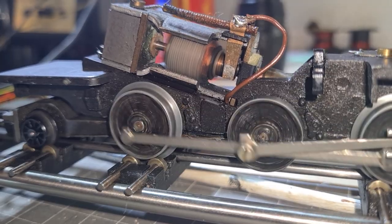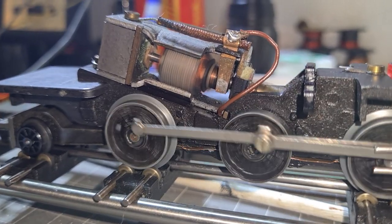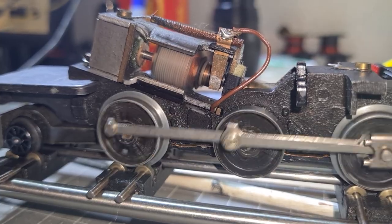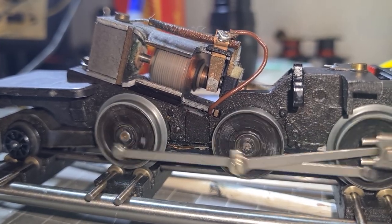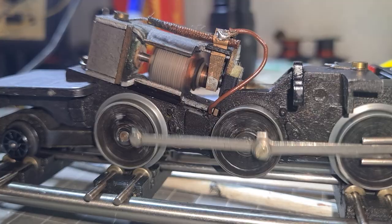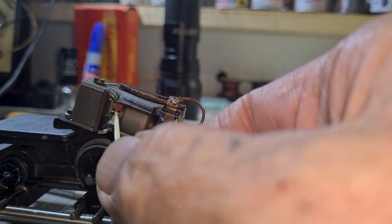You'll notice that the axle is made of steel and the housing of the bearing is brass. Over the years, I would suspect that the steel race has been wearing just a little bit of the brass bush away. Just to experiment on whether it's the pressure — just putting a bit of a toothpick in — and you'll find that that rattling basically is negated or disappears.